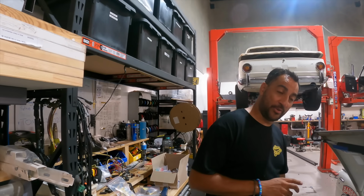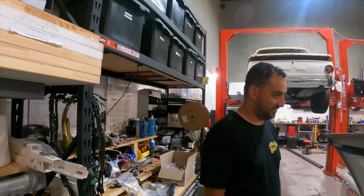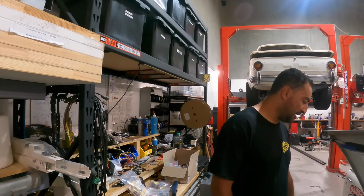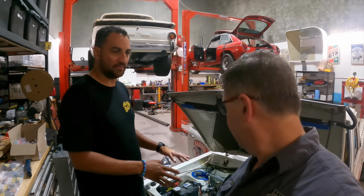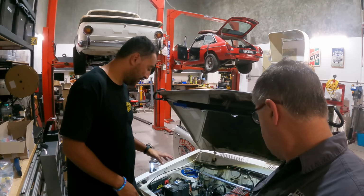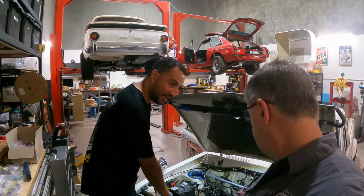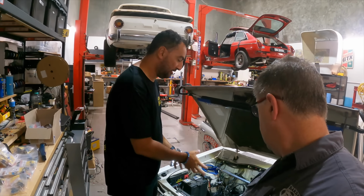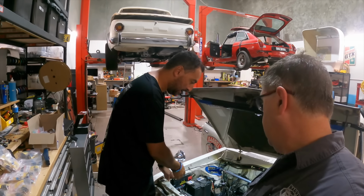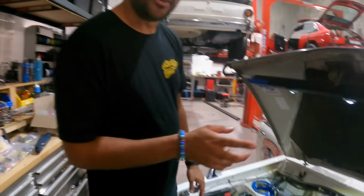Oh, right, yeah, okay. So we can do an 8-cylinder. So we've got some extra. Yeah, you've got heaps of extras. I swapped it out because what this can do, it can do your vitals and the engine. That's what I really like about it. We're running the fuel pump directly from here. We're running your aircon and the aircon fan directly from here. We're running the coil power and the injector power from here. It's doing a lot. How cool is this? We're even doing the starter motor directly from here.